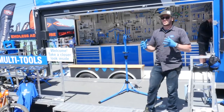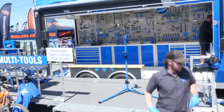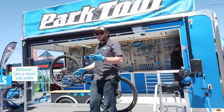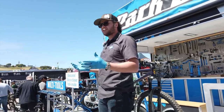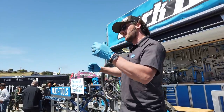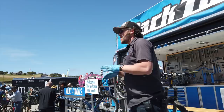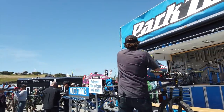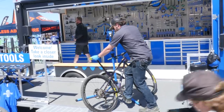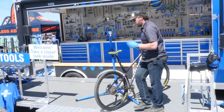When you're trying to diagnose something, riding the bike and paying attention to when it happens, how it happens, and under what circumstances it's happening are crucial. This bike is a hardtail, so you don't have as many spots to creak, which brings up suspension pivots. Suspension pivots have a tendency to creak sometimes. It's a little bit harder to diagnose, but typically it's like climbing and it's under that little bit of bob that you get on some suspensions.